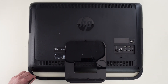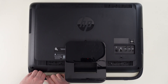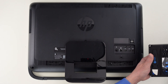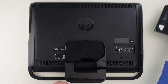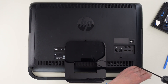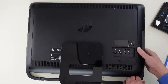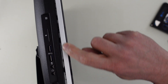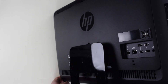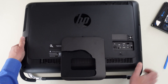The entire handle does not come off — there are two splits in it, one here and one here, so we've got to pull it up. You could use your fingernails or a small dull screwdriver. If you have an iFixit kit, there is a plastic tool that is very helpful for this. Since this thing is just like a big laptop, that's what this tool is for — to take covers off without damaging them. Then we make sure the other screws have come loose enough to remove the entire back panel. If you're doing it right, you should start seeing a split between the front bezel — in this case a silver painted bezel — and the back cover. There are angled snaps at the top, so as we pull this off we'll hear snaps occurring, and then it should come off at the front.